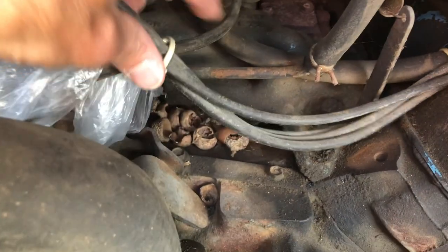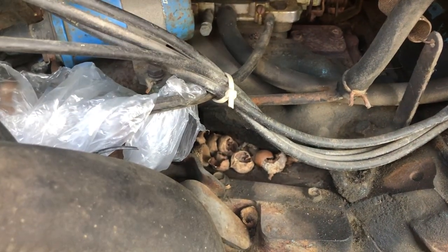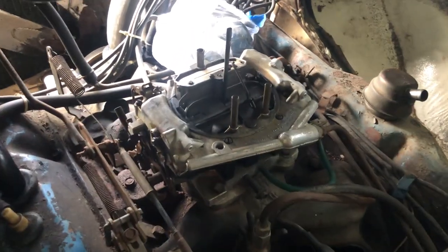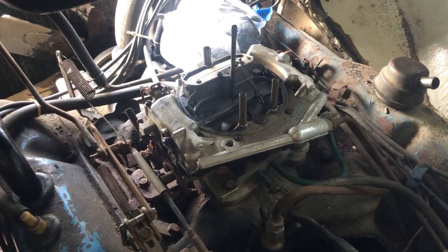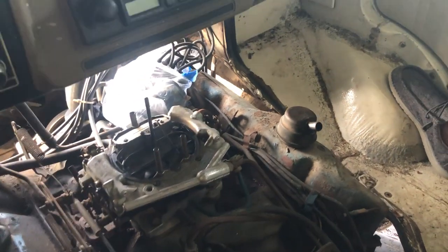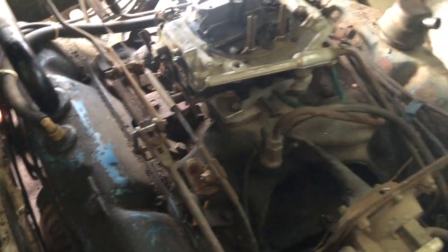All right, so as you can see, there's been some critters doing their thing up underneath the hood here on top of the engine. I'm going to go ahead and pressure wash the engine and at least the top side of the transmission before I do my oil change and take the valve covers off, the exhaust manifolds, and dig any further into the engine. I kind of want a clean surface to start with, or at least as clean as reasonably possible. We're sitting inside the camper - underneath the doghouse here is the rest of the engine. What we'll do is put plastic over top of the carburetor so we don't get water down there, and plastic around the outside edge here and up over the dash. Then I'm going to bring the pressure washer wand in here and hose this bad boy down.